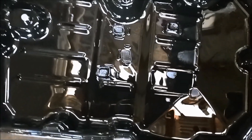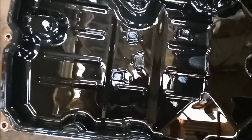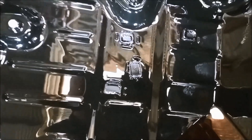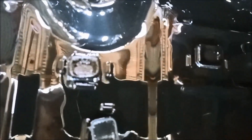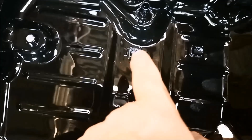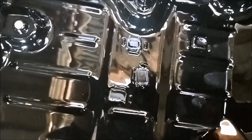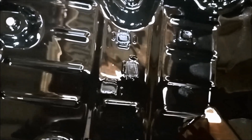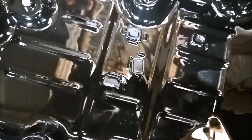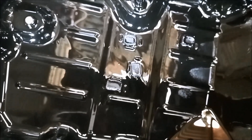The importance of actually removing the pan — not just doing an oil change on a transmission — is to clean these magnets. You'll see this one's only done 45,000 Ks, but there's a fair bit of rubbish on the magnets there. You don't want that muck ending up on the solenoids or the sensors. Once the magnet becomes covered in that muck, the magnet can't attract any more rubbish, so it ends up on the solenoids and your sensors. The cleaner you keep it, the longer they last.